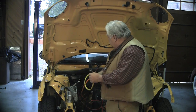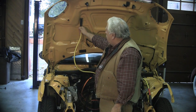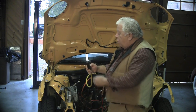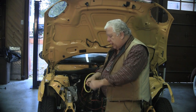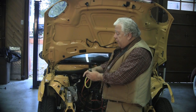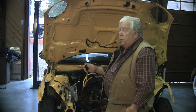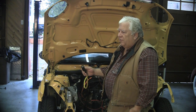What I've done here is hooked in about a three-foot cable that will eventually reach to the front of the car. We'll probably have it up on the hood with some little clips, but you can pull them off and plug the cable in here. This is the negative cable. This is a welding quick disconnect — it has a little cam lock where you put the other end in and simply twist it, and it locks. It's a very heavy connector with a big hex nut you tighten down on the cable. Very easy to assemble, with very thick insulation on the outside. I like insulation, but it can get cracks, it can get moisture — I don't trust my life to insulation.